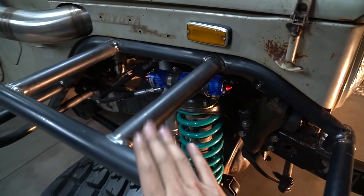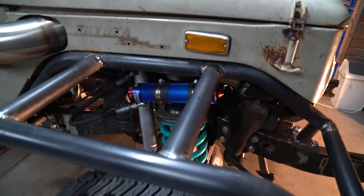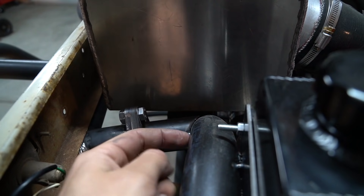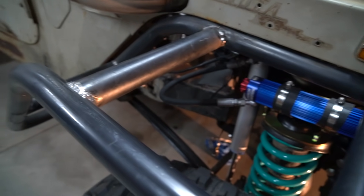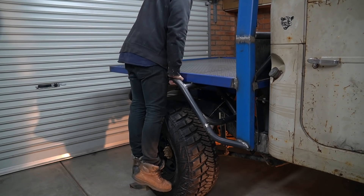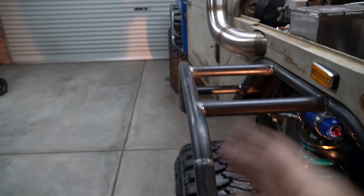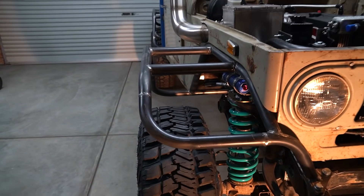One of the cool things about this design is that it integrates into the main roll hoop. So this is now a very structural member and it really stops the roll hoop from flexing if it gets hit by anything. From the front, these are an absolute pain to mount and get the fitment right. I'm going to skin them with 3mm alloy and I used window packers to get a 5mm gap. These took a couple of days to get all the bends and everything right. Another mid-mounting point is from my radiator brace straight into the guard, giving it extra rigidity. These are completely structural guards — I'll just demonstrate by sitting on them. I've effectively got external scrub rails as my guards, which means I don't need another piece of steel as a scrub rail. Getting them parallel was really hard — my ground's not level, the car's not level, so a lot of it was string line, eye, and window packers.